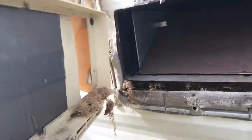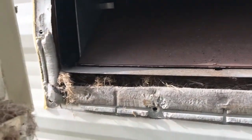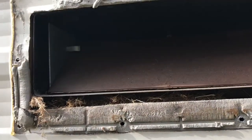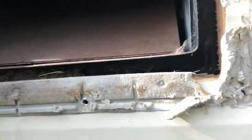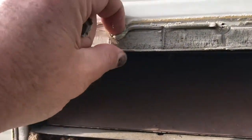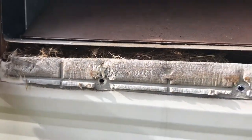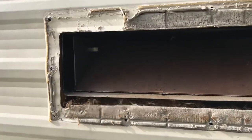Let it vent and break the seal. Here's what you got. There's some duct tape on there from a crack that was there originally, temporarily patched while we were camping. Looks like something started to build a home there. Here's your vent and another damper there inside. There's some duct tape on there inside for the fan. Peel off your old putty — we'll clean that up with some rubbing alcohol and get the shop vac and clean out all these little grass clippings. Probably a mouse.